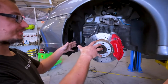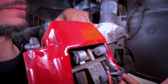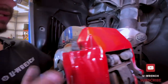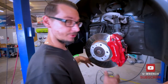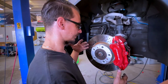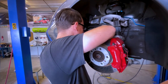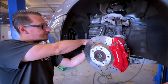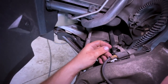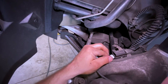I'm going to explain what I have to do because this strut slides into the knuckle — you can see it actually comes very far down. So we have to get the knuckle off of the strut, which on this means taking the entire knuckle out of the car. Sure, it's excessive, but this actually comes apart really nicely — it's not very difficult. I'm going to start with the wires, and really all they do is unclip. We have the two wheel speed and ABS sensors, and this is like the sliding clip — you just pull them out. If all clips were like this, we'd have no wars.